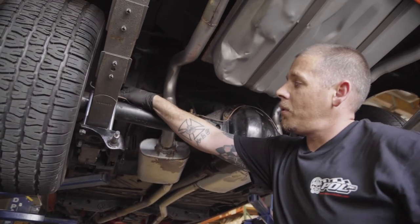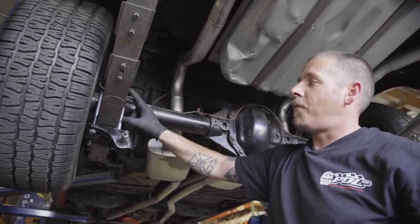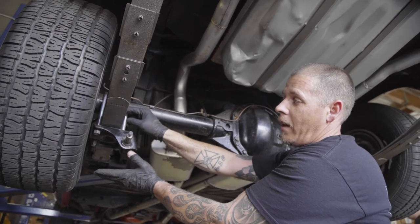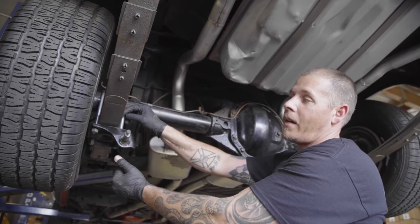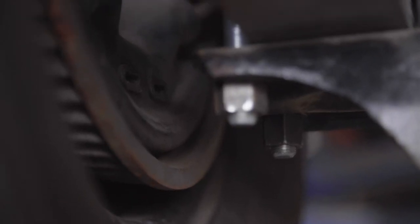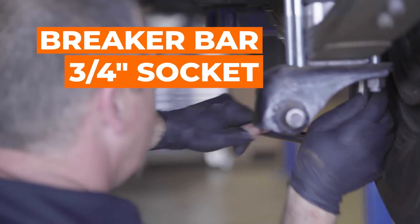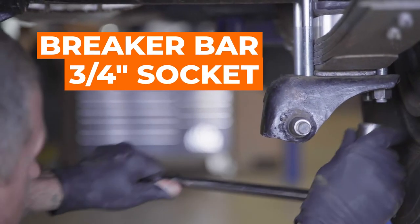With these U-bolts, normally they basically double if you want to do even a four-inch block — they're a lot longer and you've got to cut them down. These have already been cut to the desired length beforehand. We don't recommend using a lowering block any larger than two inches, and no larger than one inch for high-powered applications.